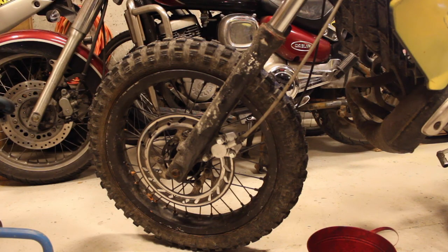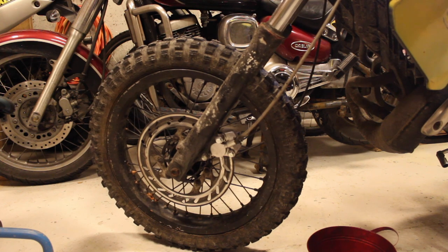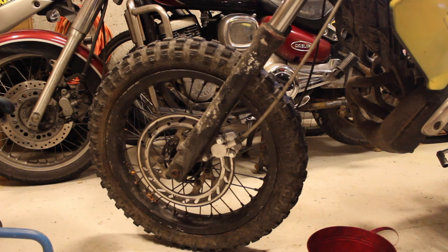The caliper is back on, and now it's time to bleed the brakes — meaning you have to let out a bit of oil to basically dump all of the air out of the brake system, essentially making the brakes work. I'm going to show you how to bleed the brakes. It's pretty easy — usually easiest with two people, but you can do it with one person as well, no problem.